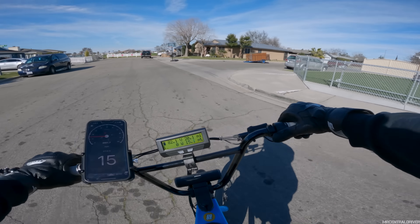Let's get back to the house because now I want to try going to a higher wattage and see if that helps our top speed. We're back — I did check with my phone and we hit 41.5 miles per hour on that three-mile trip. I'm charging the bike just slightly to get a little juice while we tune. I'm going to go into basic settings and put it at 3500 watts. Let's see what 3500 watts does. The max battery current — I'm going to set it to 55 amps. That's all we're going to change. Let's get back out there.